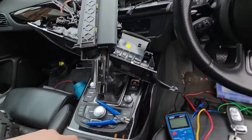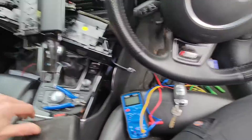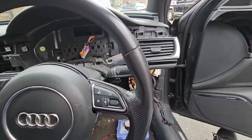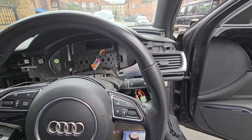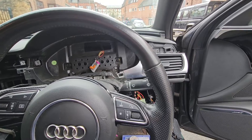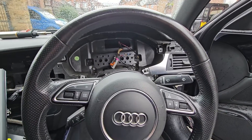What I'm going to do is cut this wire, which has continuity to the heads-up display and the instrument cluster because they're all on the same feed. I'll splice in a wire here, run it up to this connector, and put another splice into this red and yellow wire, solder it in, hide it all, and put it back together. That's the only way of doing this cost-effectively without ripping the car apart. I've got my soldering iron, connectors, and wire ready. I can't film the work because I'll be using both hands.